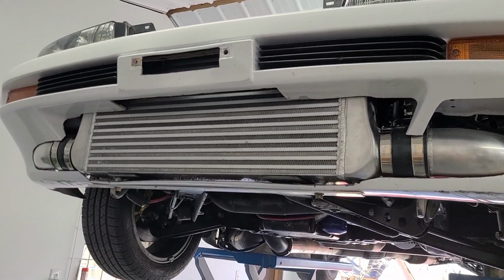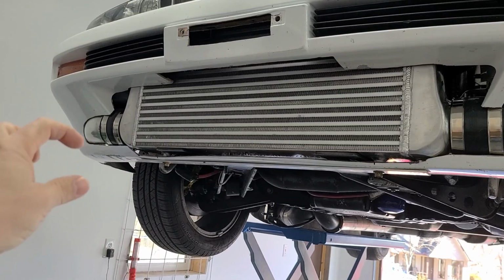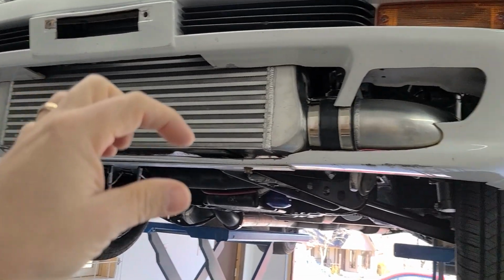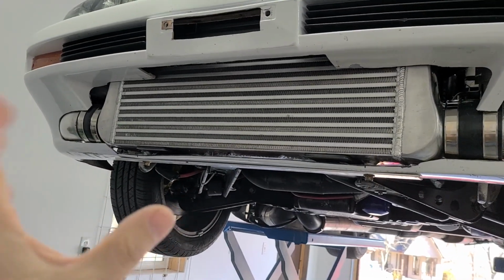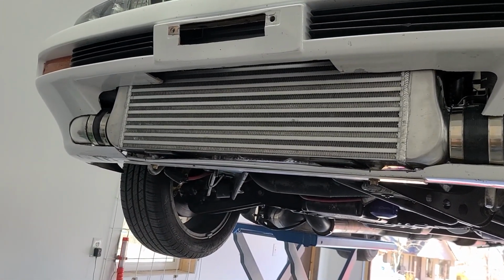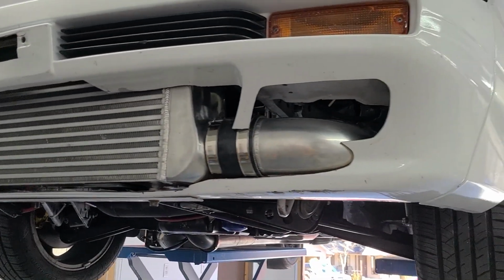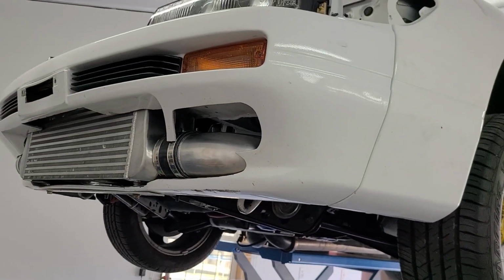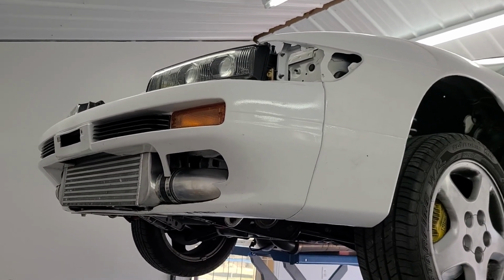And then step number 2 would be to build sort of a wooden jig underneath it, and then fill in with expanding foam all the way around here, and then carve that back to a nice shape, and then fiberglass over that, and in that way just making a nice lower lip for the bumper. I've never really done anything that elaborate with fiberglass, so I don't know if I can even pull all that off, but that's kind of where my head's at around that right now.